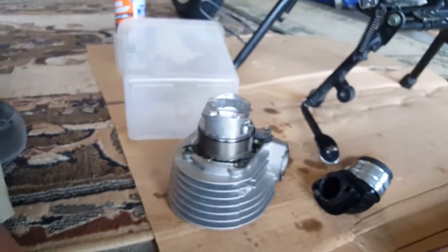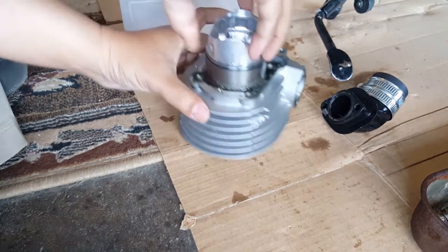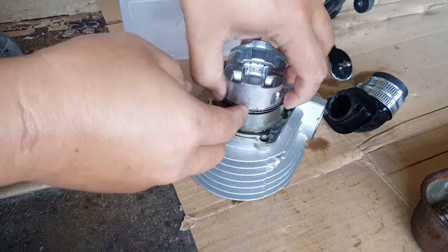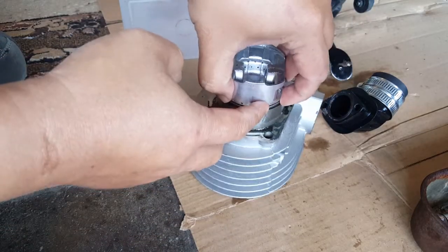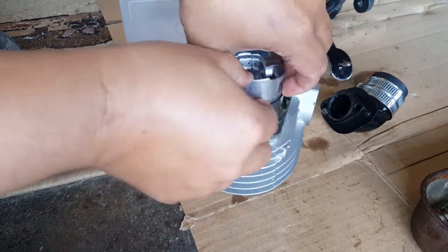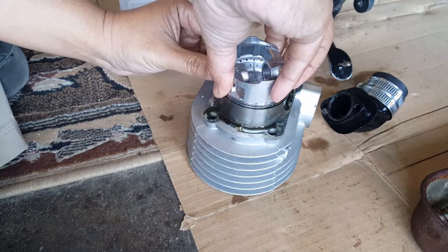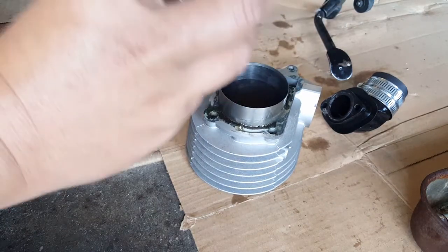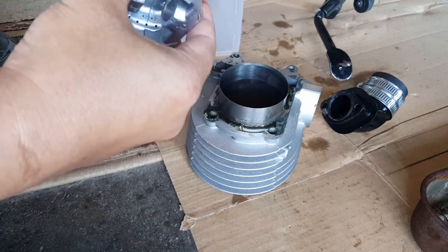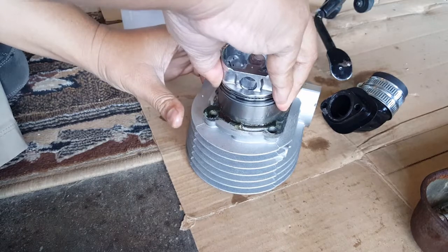And then we got to take a measurement for our shock bolts as well, because I need to get that one squared away. Trying to find one that's about no more than 35 millimeters in length, just to be perfect. It could be 40, but I think 35 should be the maximum. Okay, I want to make sure I don't damage any of the piston rings. Piston rings are still good. You can see the side walls here.